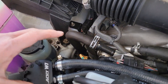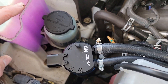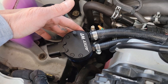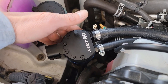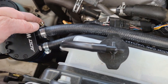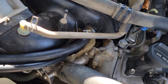If you really wanted to avoid paying for the actual vehicle-specific catch can, you could probably just run a universal catch can, which are a lot cheaper - like $40 on Amazon, and they also have them on the W1 site as well. Just make your own bracket from angle iron, get your hoses from the auto parts store, and you're good.